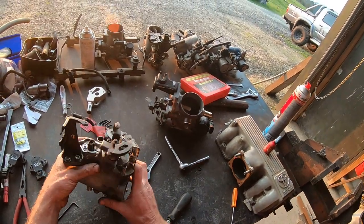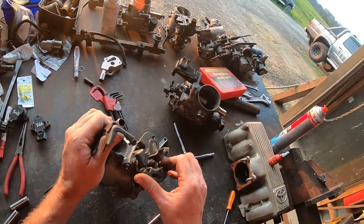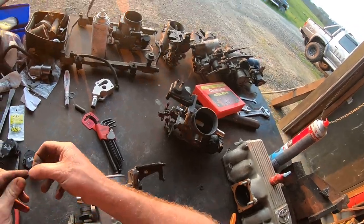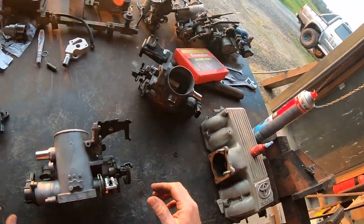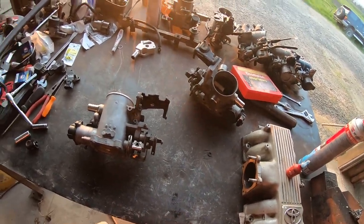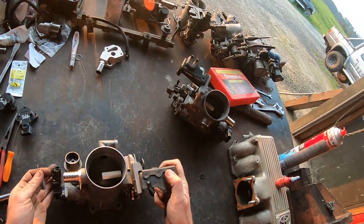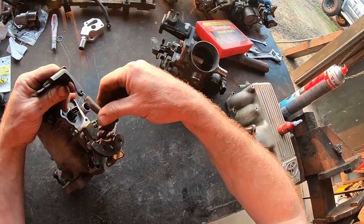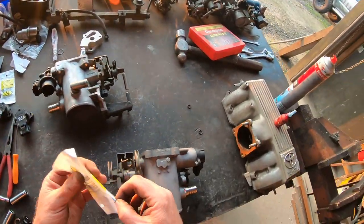When we look at this top screw it should just be popping through - probably two and a half, maybe three millimeters down underneath. The throttle stop is actually underneath. If you're setting up an aftermarket computer it does pay to set the base idle by adjusting that screw underneath. You bring the idle speed up to when it's warm about 100 RPM under what you want the idle to be, and then you leave your idle speed control unit to do the last 100 RPM.